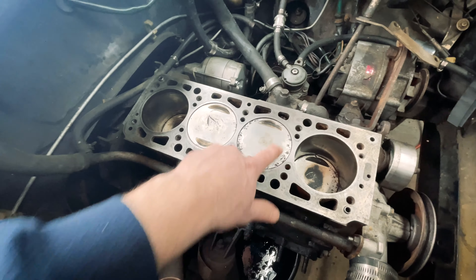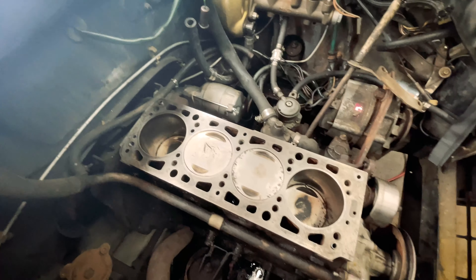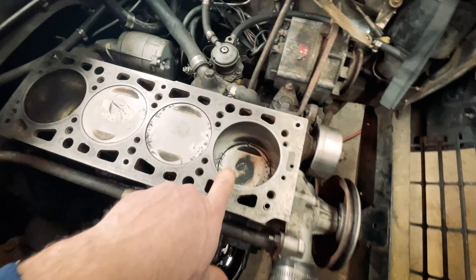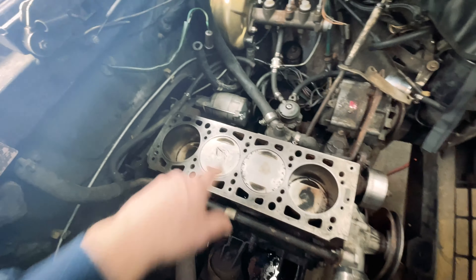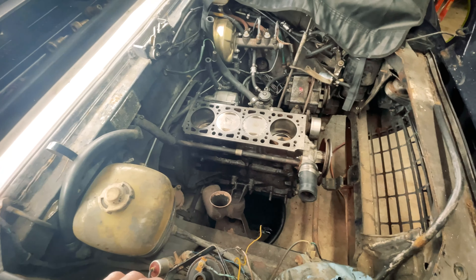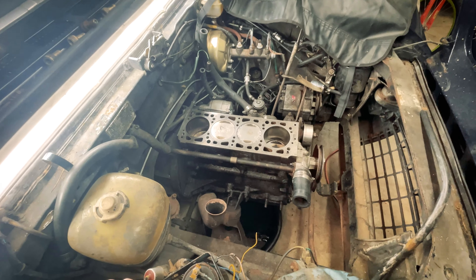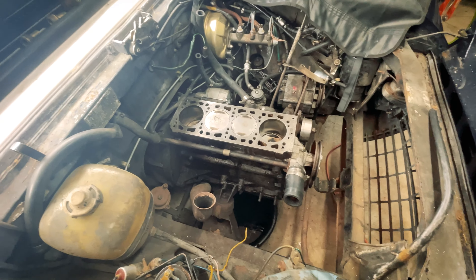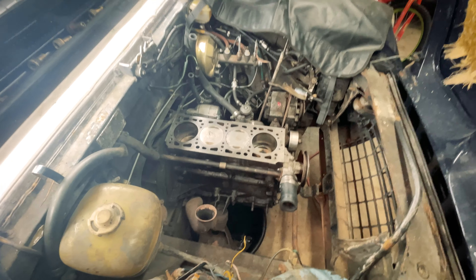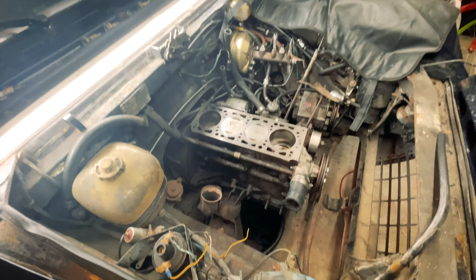I'm not sure, but you know what - I don't care. I do have another extra piston I can swap out if I really need to. At this point I'm going to slap this new head on here and bolt it down real quick without any accessories on it. I'm just going to spin it around a few times, see if it holds any compression, and if it does, I'm gonna go for it and see if I can get this thing running in record time. All right, let's try it.